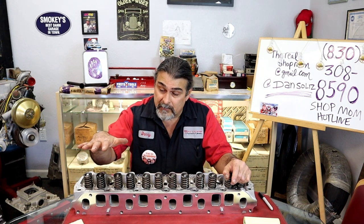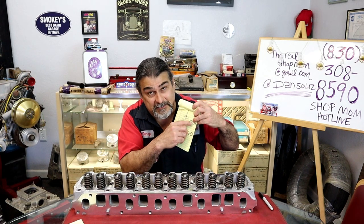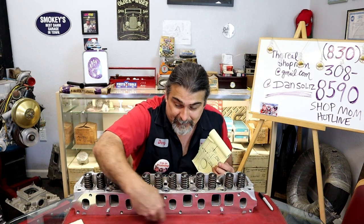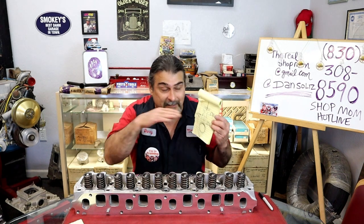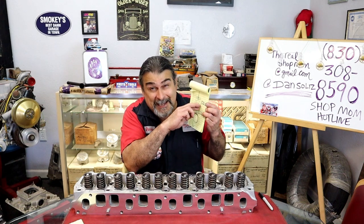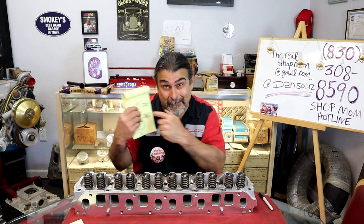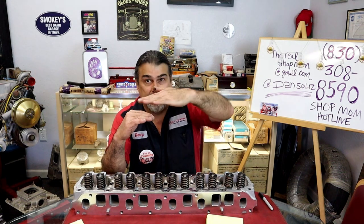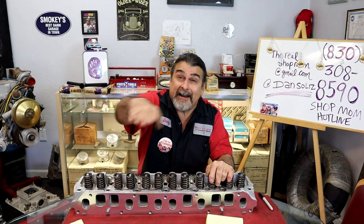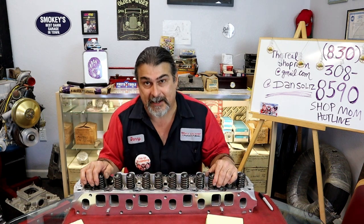I don't know how this would even work. 20 to 60, that leaves me 40 thousandths. We're at 30, what do we have, 32, 35 or something? Theoretically, these valves being like this are fitting in the window. No matter which way I hold it, it doesn't look any better, does it? Theoretically, because there's 40 thousandths of place you could be. No less than 20, no more than 60. If you're anywhere in that 40 thousandths range, it's gonna work. That's the spec. That's the production spec.